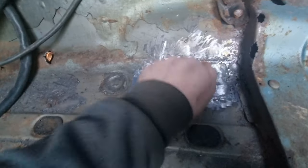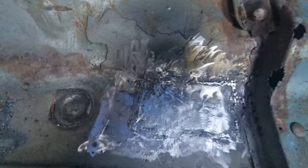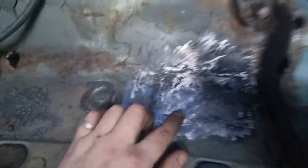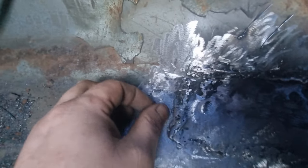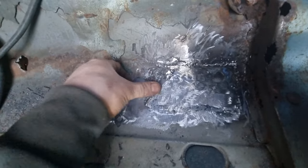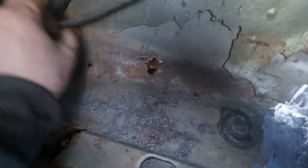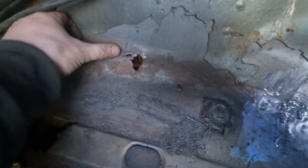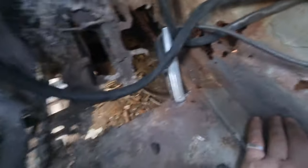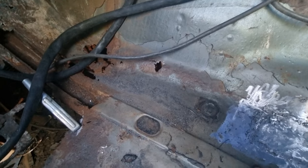So I'll fix that — that is strong. Another new piece of metal going in. All I'm going to do is put some little indents here, but I'm just going to put a skim of fiberglass over that because I want it flat. That was butt welded in there — it's not over the top, it's actually inside the metal, so that's the level. And then I've got to sort this little hole and work my way up to there. But before I can work in there, I've got to change that chassis rail, which I'll probably do as soon as possible.